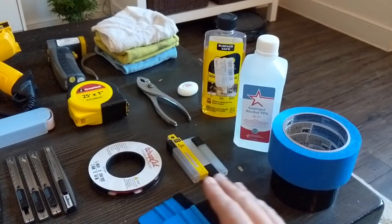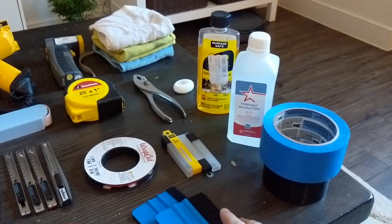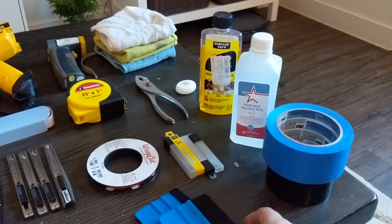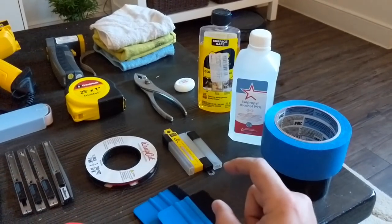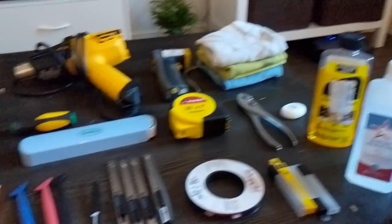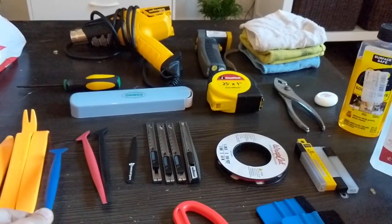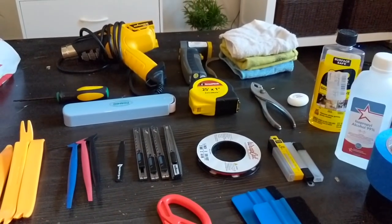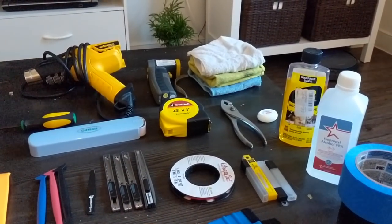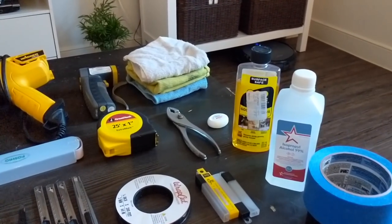Alcohol — make sure everything you're working on is super clean, dry, and hit it with alcohol before you start wrapping. Definitely a must-have. What I would do is take the alcohol on a rag, then run that rag with one of these tucking tools behind it into all the crevices you may be wrapping into. That gets all the gunk out before you wrap on top of it — make sure you have a nice clean surface.